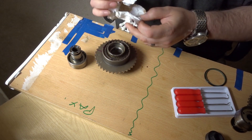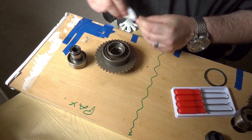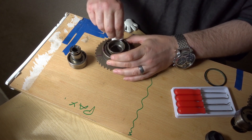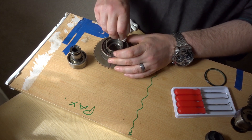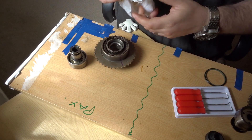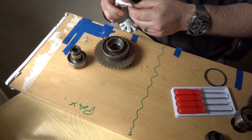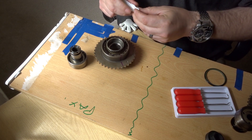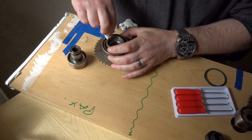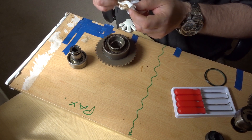Just getting down in between the VANOS piston — that's the center shaft with the helical gear. You can see the VANOS piston there. I'm just getting a wedge of tissue down in the gap, ready to get as much of the gunk and stuff out from underneath where the piston sits. I'm ready to remove the Teflon seal and the ring that sits underneath in the seal cavity, underneath the black plastic ring.